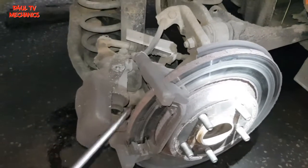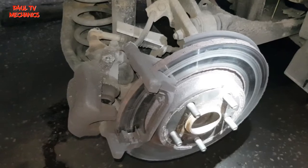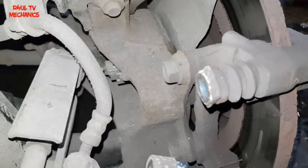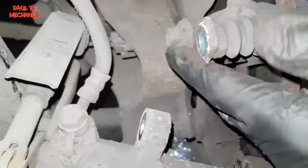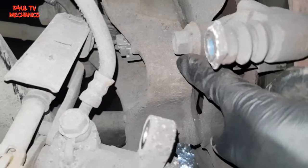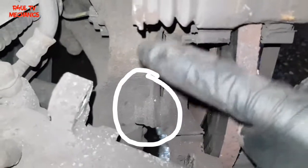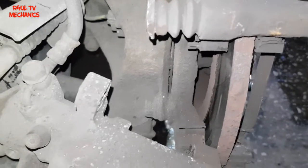Same on the other side, just take that one off. Now we're going to go ahead and take this bracket off. The brake pads are off — what we're going to do now is, I'm doing this on the floor so it's a little bit hard to show you, but this bracket here, the caliper bracket — we're going to take that bolt off. I think it's a 17 milli socket. Take them two bolts off, hopefully this bracket comes off, disc should go straight off, and we can replace it with a new one.